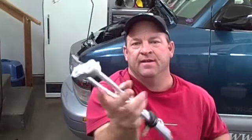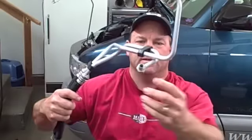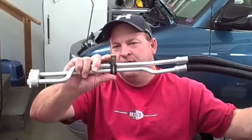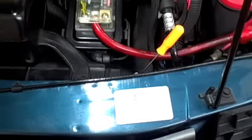These do go out quite often. This connects right by the oil filter — there's a little mount right above the oil filter — and this connects to the radiator. We have some quick clips that we're going to have to remove to get these off and get the other one in place. And then there is a 10mm bolt right here where it connects to the block. Other than that, it should be pretty simple and straightforward, so we'll go over to the car.